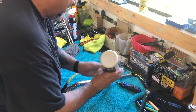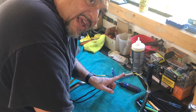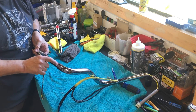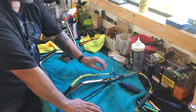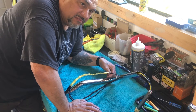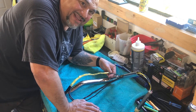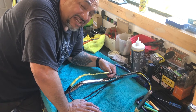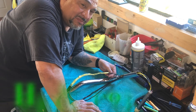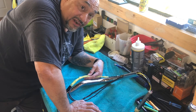I had to stagger the wires with the first set and then the second because those are actually longer. I'm going to throw a little bit of lube down in here. Regardless of how thick the bars are — inch and a quarter or inch and a half — they're always an inch at the ends where they mount. So if you have connectors and get them all the way through and you work, work, work, work, and then come to that end, there's a chance they might not get through. Or if they're meat hooks with a bend, they're welded on the corners and the welds on the inside don't always get bored out. That's why a lot of people like getting thicker bars — at least inch and a quarter to inch and a half. The inch and a halves are a lot easier, and American-made bars like KST, Factory 47, or LA Chopper are usually bored out, so you're not going to have much trouble getting your wires through as long as you have no connectors and stagger the wires.